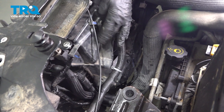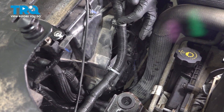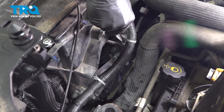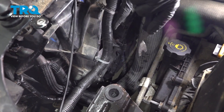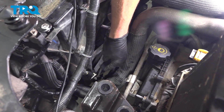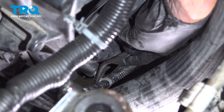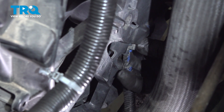Now we can start disconnecting things from the fan shroud itself. Come right over to the hood release cable and pop that out of place. Continue dismounting the wiring, making its way all the way down to the driver's side connector. Use our trim tool to get in between this area and separate it. There's another one hidden down inside this area — it's a little bit harder to get to. Make your way to the connector; there's a little tab you can squeeze in and pull this out of place.